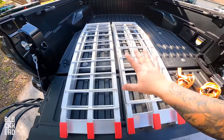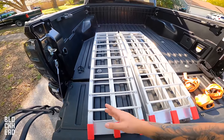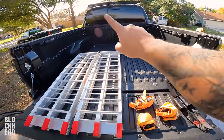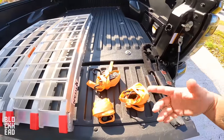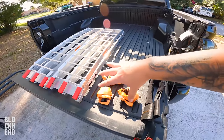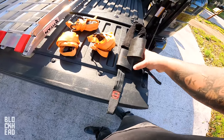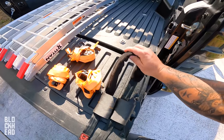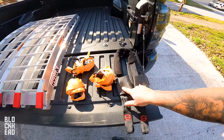We've got two ramps. One ramp we're going to put right in the center to walk the bike up, and the other ramp we're going to put off to the side to walk up ourselves. We've got three straps — two for each side, left and right of the bike — and then a strap for the back which goes through the rear wheel just for reinforcement. And we have this bar strap device — I'll link it in the description — it goes over the bars so you're not putting tension on or compressing the forks too much. The soft pad in the center keeps it from scratching the tank. That is incredibly useful — not a requirement, but highly recommended.